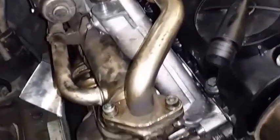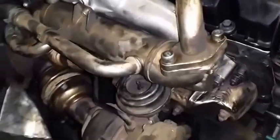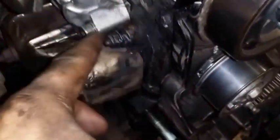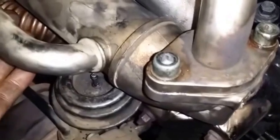So, I put back the intake manifold with the water heater or exhaust cooler thingamajig. And before all that, I put these pieces back together. The hardest part is actually making sure this metal gasket stays on the holes, so it's good to catch one back there somewhere and put her in, and then get one over here and then start slowly putting them all in. Because if you put one over here, it's more difficult to try to move this metal piece and catch it there, versus doing vice versa, where you put it back there and then screw it in.